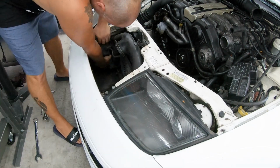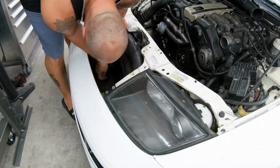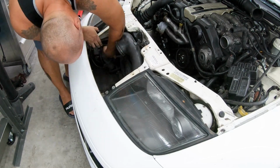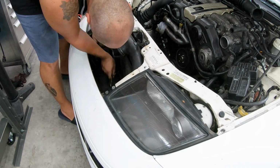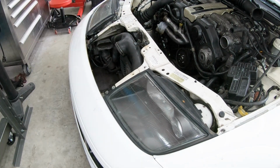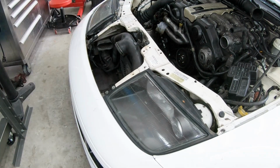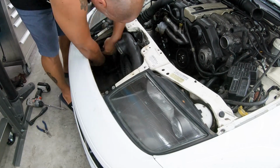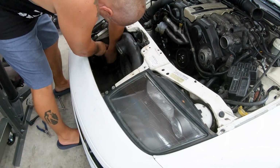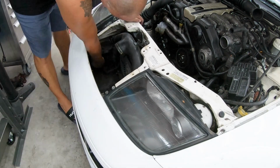Now when pulling a receiver dryer, there is a bracket that the receiver dryer is bolted into that is bolted to the car, and then there's some electrical connections that are connected to that bracket. I was having trouble getting the electrical connections off of the receiver dryer. So instead of fighting it and trying to break anything, I actually just took the electrical connections off the car and took the bracket out as well. The bracket and the receiver dryer itself all came out as one unit.